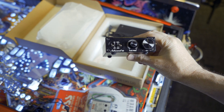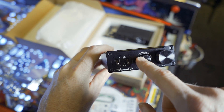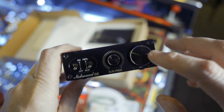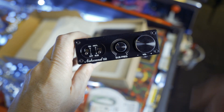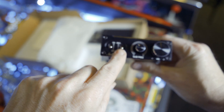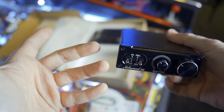One of the cool things about this amp is that you have an adjustable subwoofer control right here. This lets you dial in the crossover frequency you want. I have mine set for about 11 o'clock, which gives me a nice mid to low bass response for the subwoofer. This is your volume — I find about 11 o'clock on the dial is a good blend for me, but your taste might vary. I would recommend leaving the switch between full range and sub set to sub, and then your power switch can stay on.